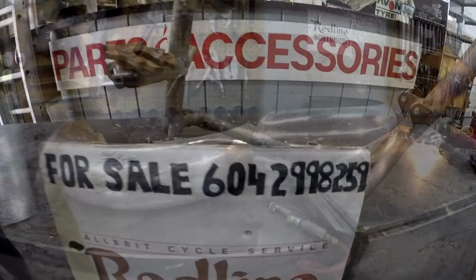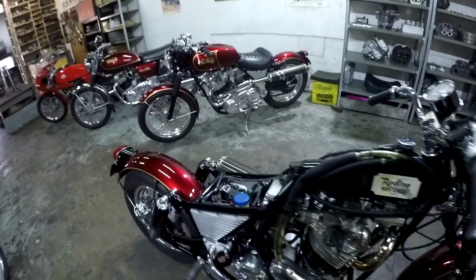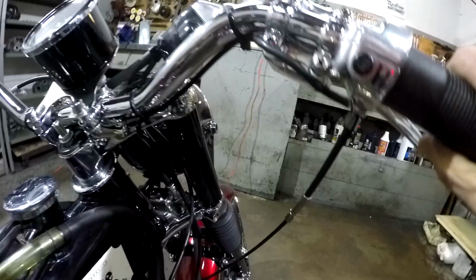So yes, let's drain the fuel out of the tank. Lube the taps after you drain the fuel. Put it back on. Oh, I got to take the drain plugs out of the carbs, let them drain for a couple days. With the throttle, full throttle, thank you.